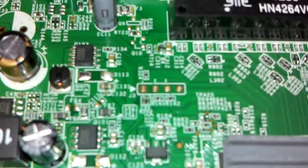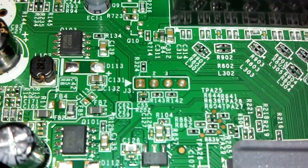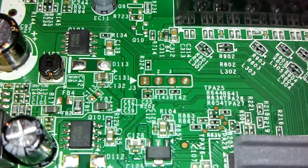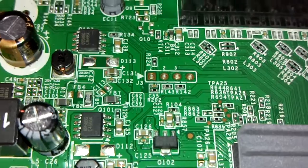Once you've got the box open, go to the front, get the PCB and lift it — it's very loose, just lift it up. Remember the antenna is on the left, sitting in a recess. There's your Brightbox PCB. There we have our serial port J3 — right in the centre of your screen you see J3, which is the serial port we use to debug the device and hack it. Shortly I'll be showing you how to access that.